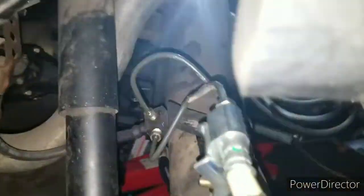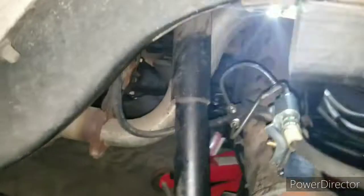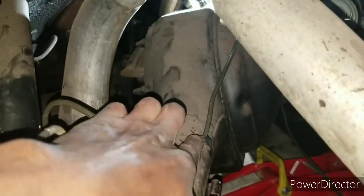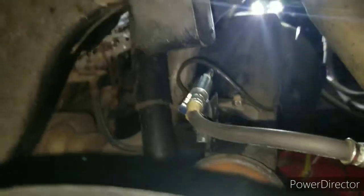All the brake lines have been basically bent to where they go. I'm using my original distribution block, as I said in a prior video, but I just wanted to show you this. So now, like I said, all I gotta do is hammer this tab where my finger is, and you secure that brake line, and it's pretty close to the factory line.